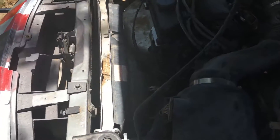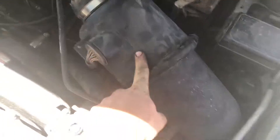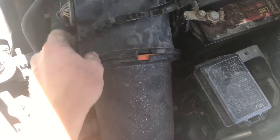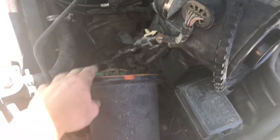I'm going to show you how I replace an air filter in a Ford Escort. The air filter is inside the cylinder here. All I do is just pop off the clip, bring it up — the whole thing just pops right up and out. The air filter is right inside here.